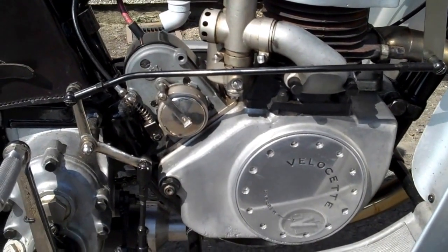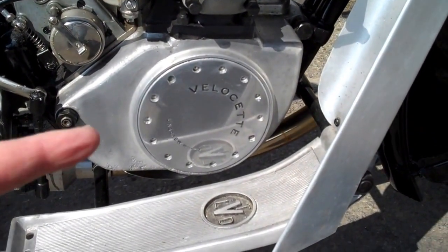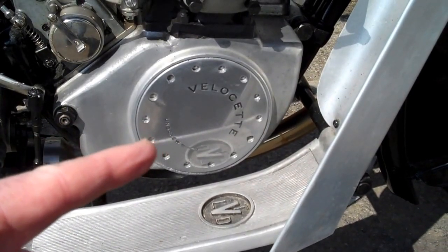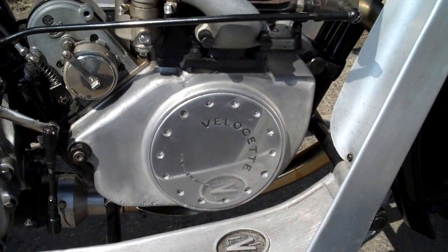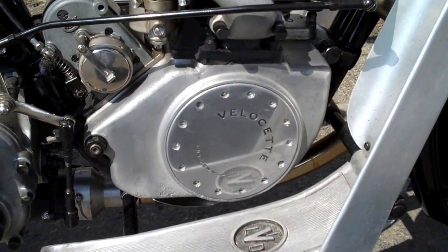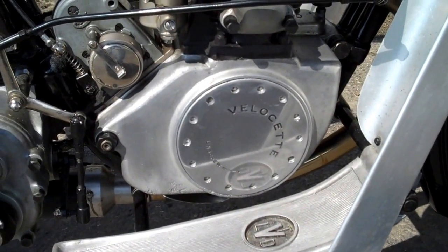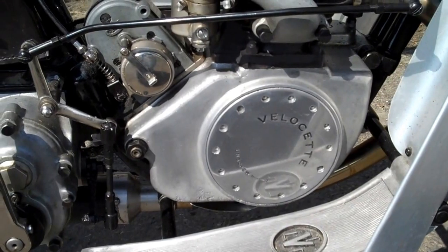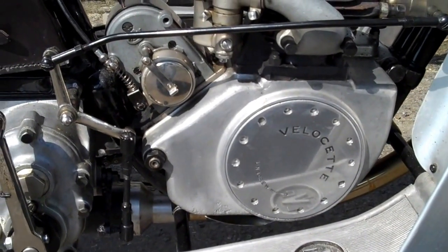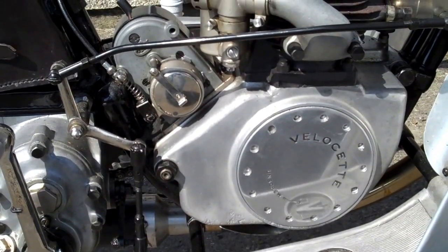You've got the Brown and Barlow carburetor. This bike has a CAV Magneto. And inside this cover — you unscrew this cover — there's a plate inside that you can pull out, and there you have the overhung crankshaft in that space. It's quite a long big end — a bronze big end that goes right through to the other side to the flywheel. So when it's running, the oil is pumped through the big end into the engine and is burnt.